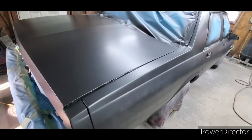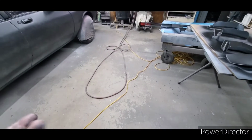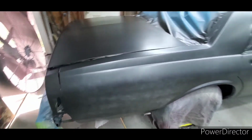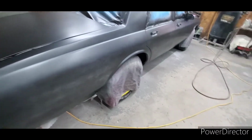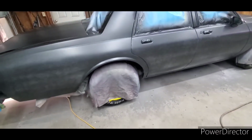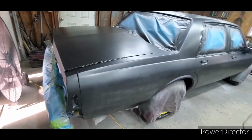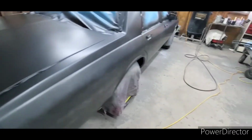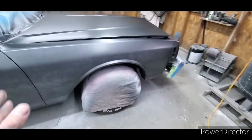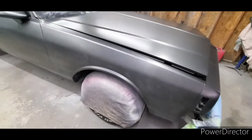Sometimes you can go ahead and get away with it, but I still recommend a heater to heat up your paint, your gun, get the metal warm, get the molecules warm like I discussed before, and I think that goes a long way. I think I'm going to attempt to spray these sides. I'm going to let the fumes evacuate, and then I'm going to heat it back up in here because the temperature is starting to drop. I can tell it's getting pretty chilly in here again. That's definitely going to hinder the drying, and I want to get the base coat done today, so I don't want to have to wait an hour and a half in between coats. And again, I'm only using a medium reducer. But it's coming along. I think this color is going to be spot on for this car, and we'll see you in the next clip.